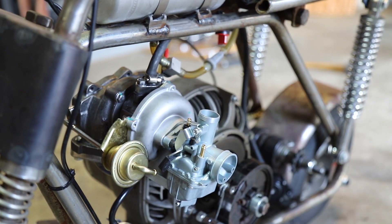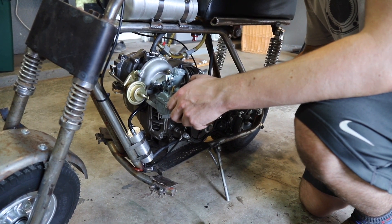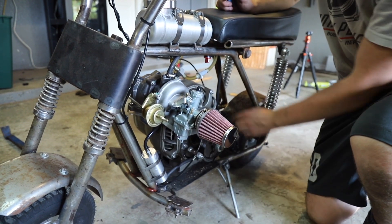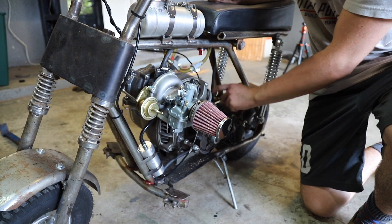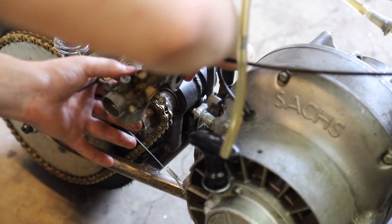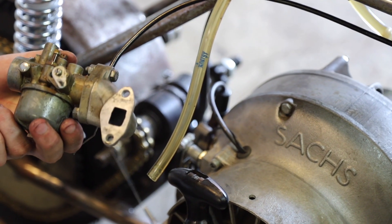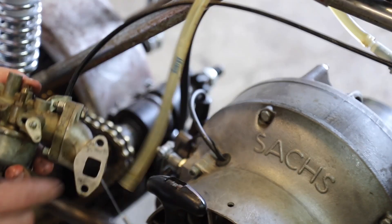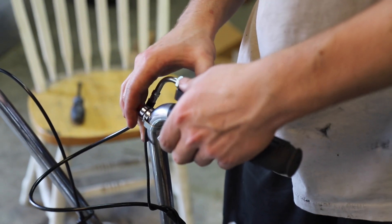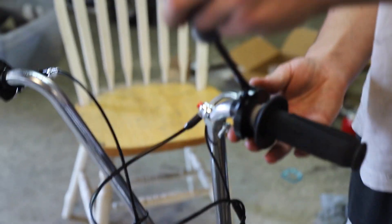It's a little invasive but it looks cool. We got the Mikuni filter on. Now we need to connect this to our port over here, so we'll take off the carb and see how we can loop it around - it's gonna be tough. Look at how small that port is, it's like my fingernail. Back to the drawing board to figure out how we're gonna get pressure through that. We got our Mikuni throttle in from Go Power Sports, so we'll get that bolted up.